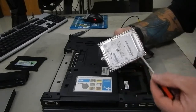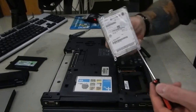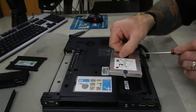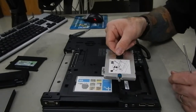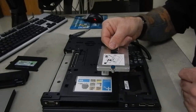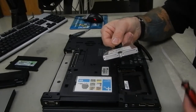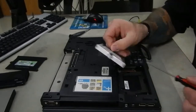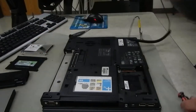Then we can take the whole thing and just lift it right out. You can see there's our hard drive. Four screws hold the carriage and the hard drive assembly together, giving us the mounting holes to attach everything. It fits in there nicely and it's a little bit padded. The next step in your manual has you disassembling this part further, but you do not need to do that — we'll leave the carriage and the hard drive together for now. And that's the removal of the hard drive.